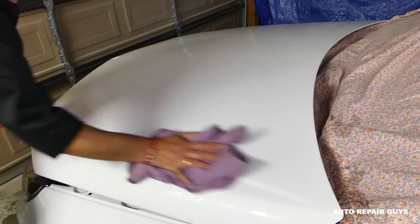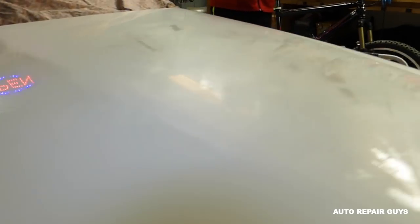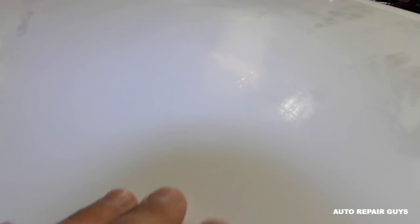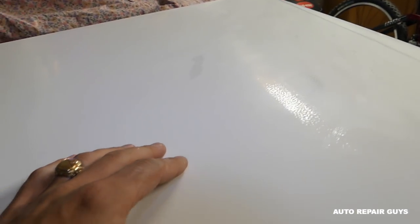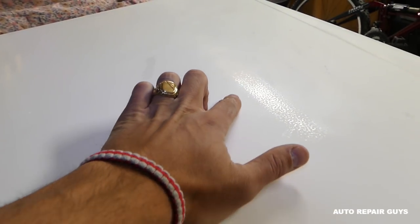It's drying now. I can give you an idea of what it needs to look like. You can see the finished side is shiny, while the sanded side will look matte — no gloss finish at all. If you have little holes here and there, that's fine — you can replicate original orange peel. It needs to look matte. But this side still needs more work, so keep checking by drying it.